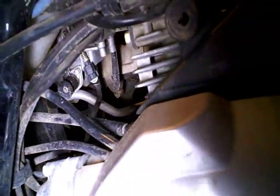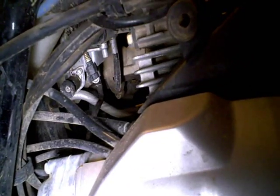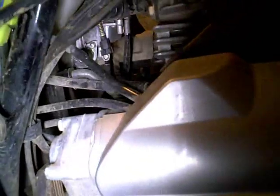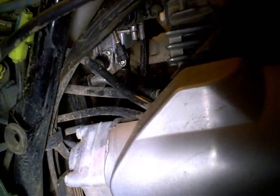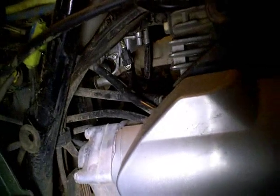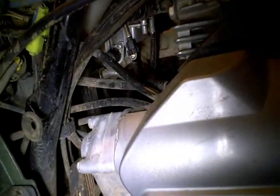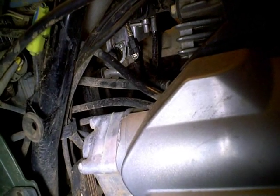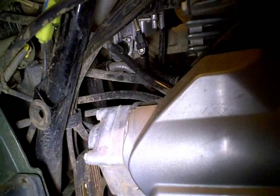Hopefully you can see it there, right? Basically directly below the idle adjustment knob there is a drain screw. One thing with these things, when people have difficulty starting them, especially in the winter and especially after they've been sitting, gas goes stale fastest in small quantities, like in the carb float bowl, where it's exposed to air.